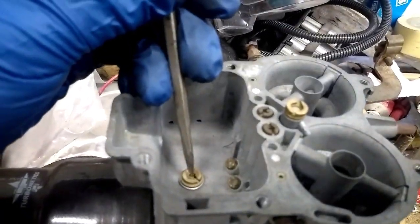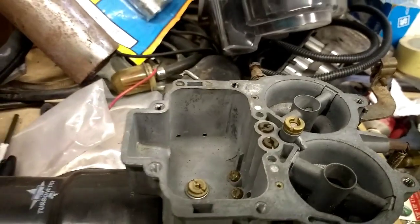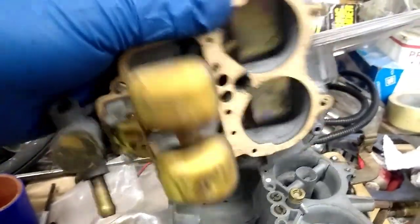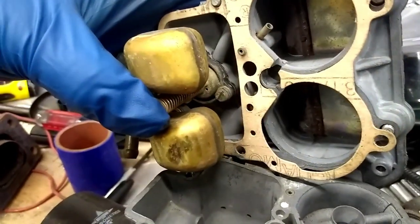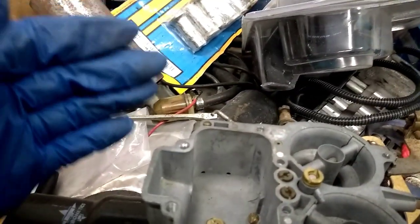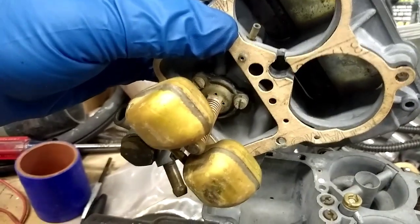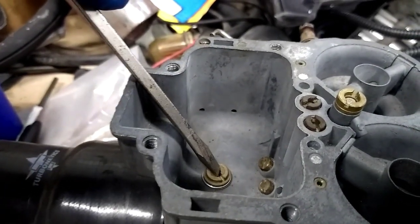When you push on this little center button, that goes down and lets fuel go into the chambers and into the main jet stack, enriching the mixture. How this one works is this long rod and spring on the bottom in between the float — when vacuum is applied to it, it lifts this up. When this is lifted up, the needle is spring-closed. At full throttle, when vacuum is low and atmospheric pressure is higher, it releases pressure on that spring and lets the rod come down, pushing the little needle in the center down and letting fuel in.